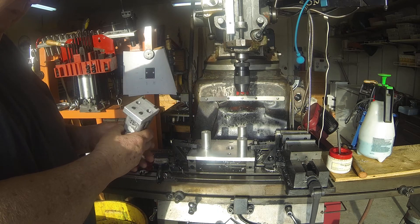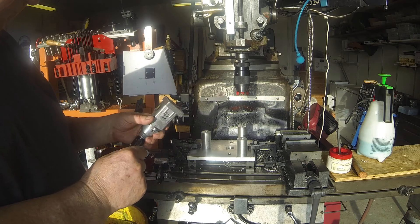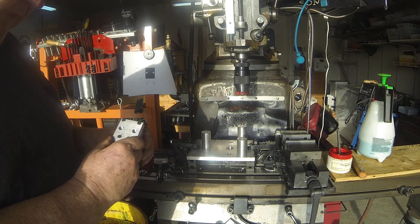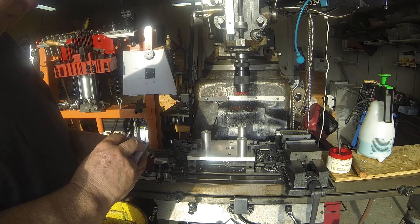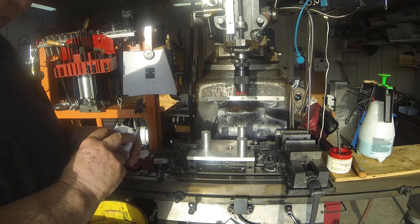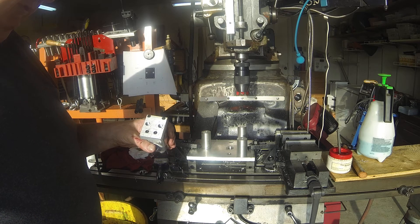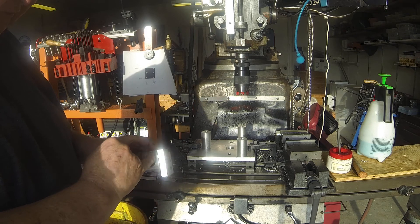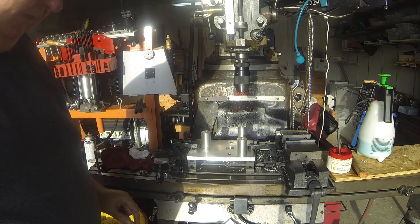I've also done the mod to the top of the butterfly — removed the butterfly and its top plate, made a new top plate, and it's got some milling inside. You have your clockwise and counterclockwise holes here; these are drilled and tapped for 1/8 NPT. It's got the original gasket in there and I've checked it for leaks — it works great.